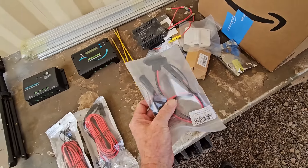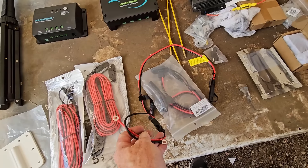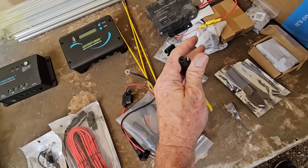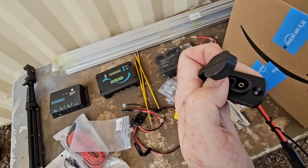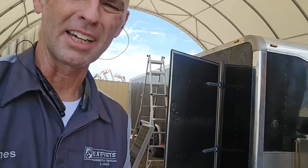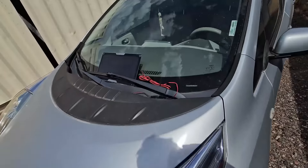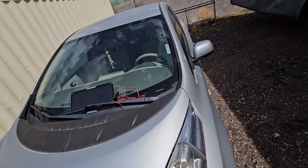My plan is to make a couple of harnesses and outlets to plug into. These harnesses will be connected to the car batteries with their own fuse protection. When you want to charge up the cars, you just plug in this harness into the 12-volt outlet inside the trailer. I know some of you might say 100 watts to maintain two car batteries is overkill — why not just get a simple 15-watt battery maintainer? But that's not what I was asked to do, so we're going to do it this way.